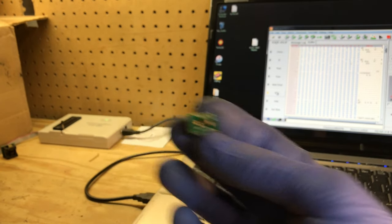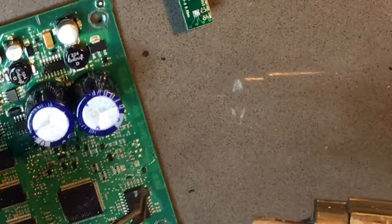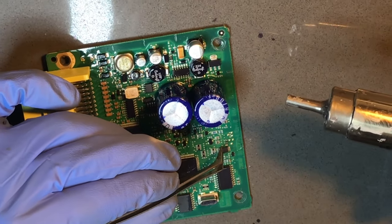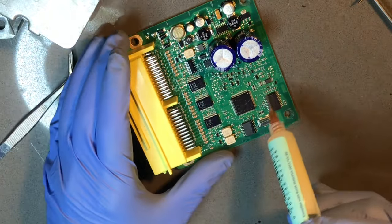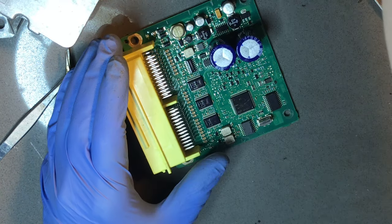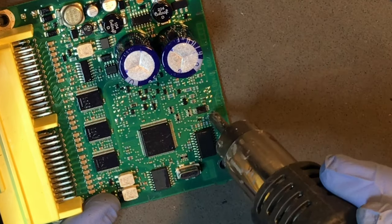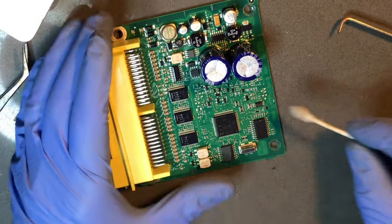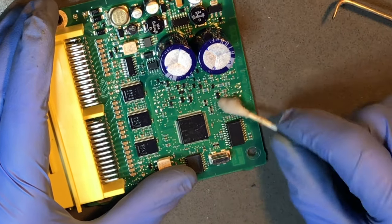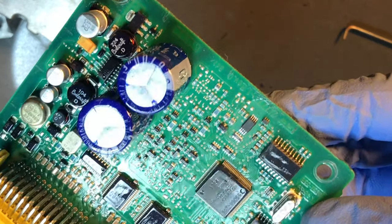Now let's go ahead and transfer this chip back into our module. If you're interested in the tools I used — such as the chip programmer or the hot air station — I'll leave links in the description field under the video. I've got the chip lined up in there pretty good. I'll put some flux on there and hit it with hot air one more time to help the solder flow better. The very last step is to clean some of that flux up with rubbing alcohol on a Q-tip, just working it all around. This is what we ended up with.